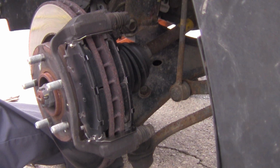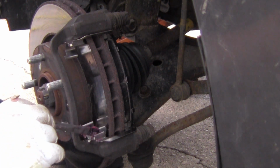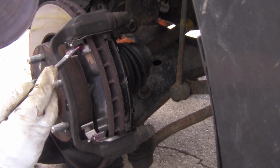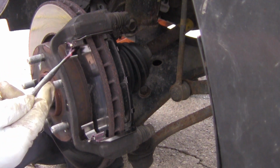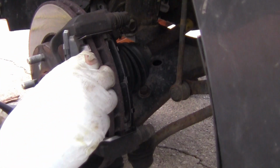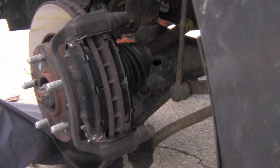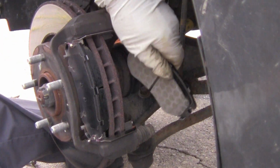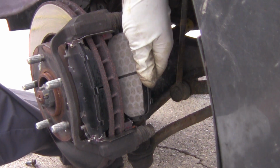Now I'm going to go ahead and pull them out one at a time, grease them, slap them back in there. I'll throw some grease right on this thing right here because this is where they slide at. Right on this square box. Get both sides of it here and on it. There we go. And I'll see if I can get it back in there. That's one. Now the other one. Okay, now they'll pull out real easy. And I should be able to put it right back in really easily. Okay, got it all greased up. See if I can get it back in there.